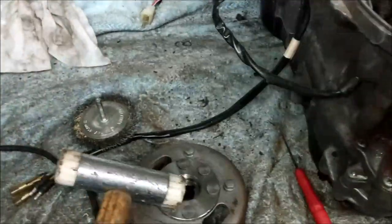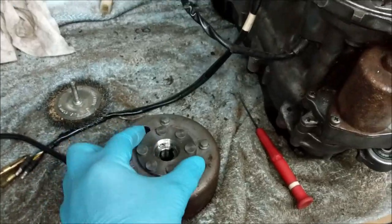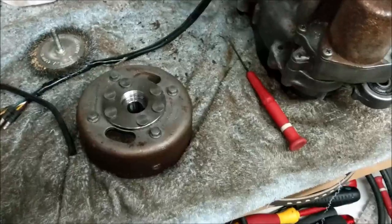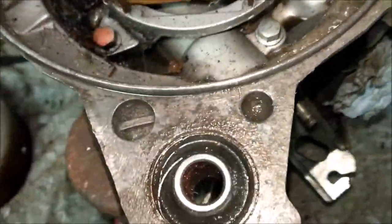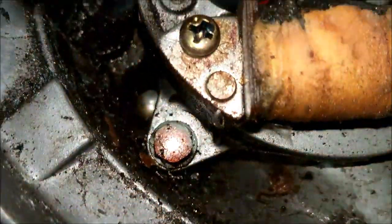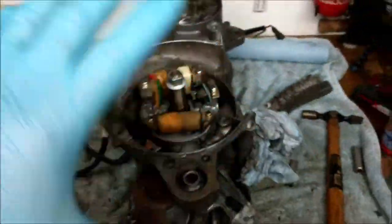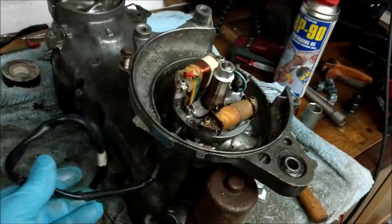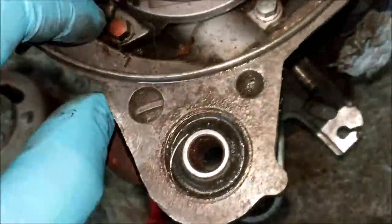And all I did was put a bit of tension on it. Just did that bolt up, probably 2 revolutions. So it was just on the borderline between the grips slipping out of here and the tie wraps giving way. And a couple of them went, bop. There we go. Jobs are gooden. Now that enables me, hopefully, to take that bolt out there and that bolt out there, and then remove this dodgy piece of wiring, because when you're moving the engine, when you're orientating it differently, this is getting squashed, crimped, pinched and all sorts. So I don't want any more crimping and pinching. So it's got to come out of there, raw, like so. Okay.